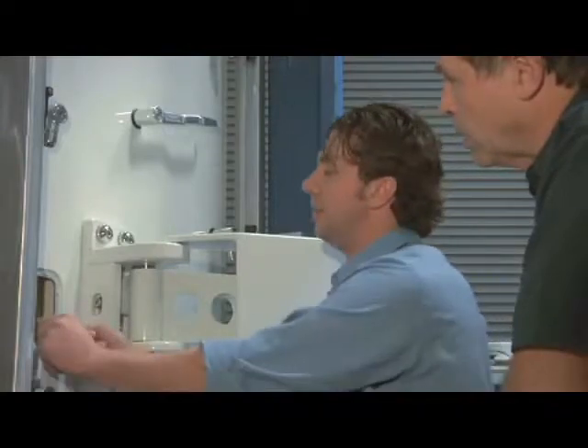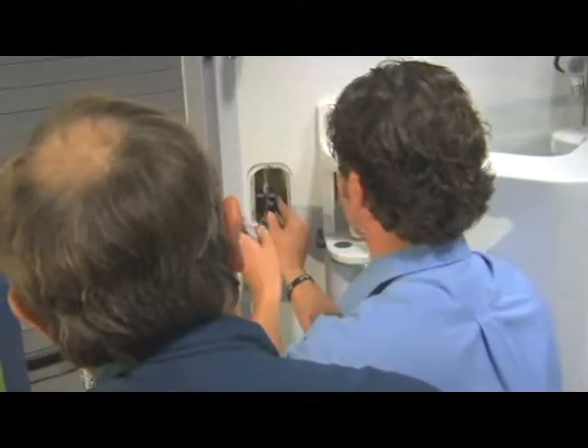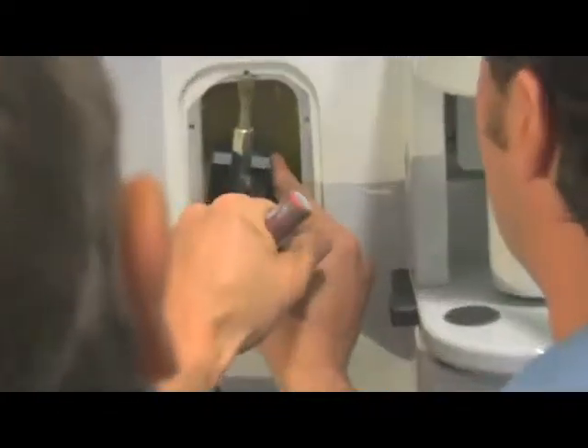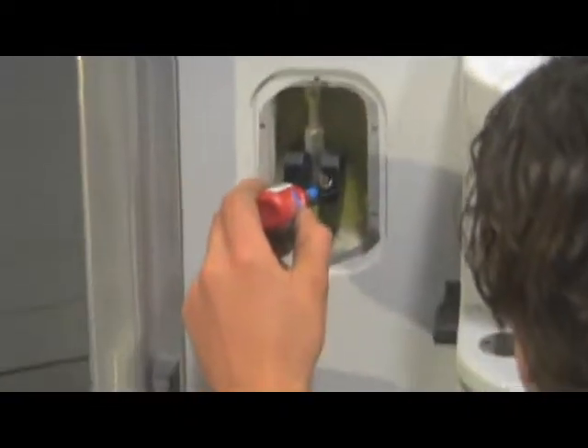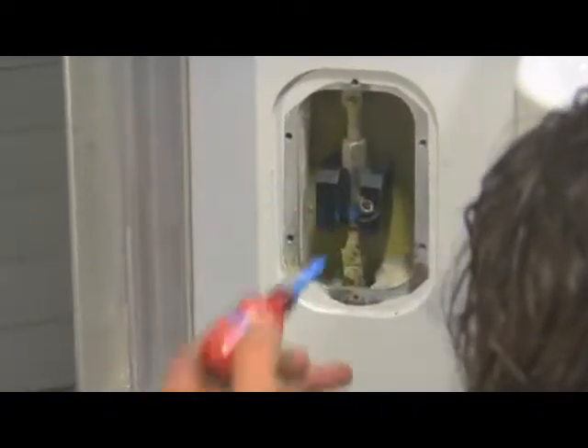What you need to do is have the sides straight so this will slide back up. The tension on the hex head should be just nice and snug. Then we'll take just a little bit of blue Loctite and put a little bit in between the turnbuckle and the lock nut, just as a precaution.